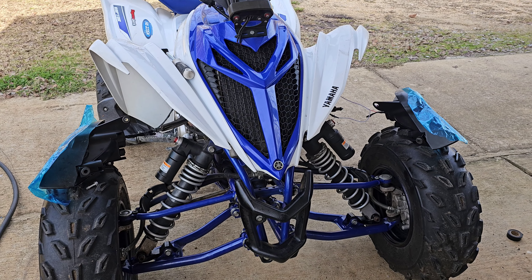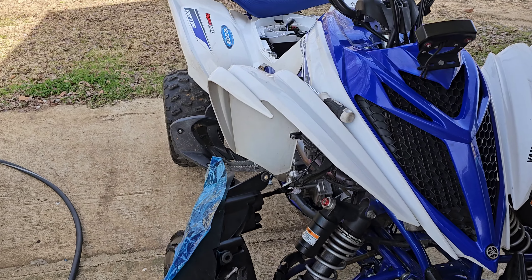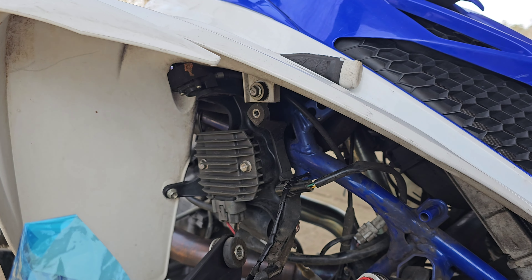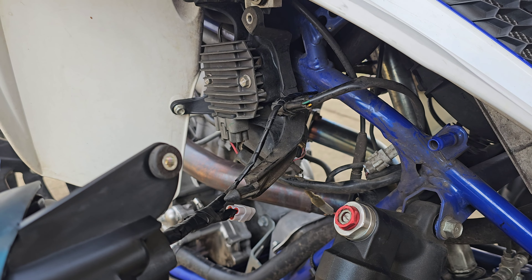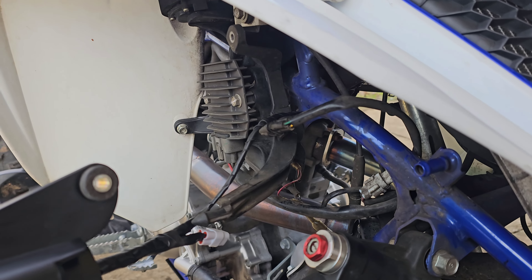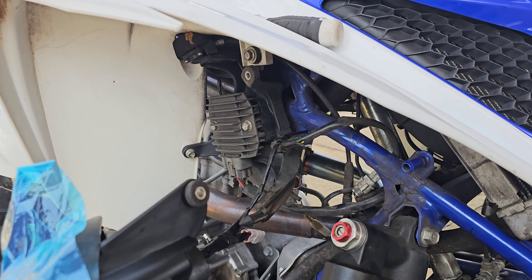Okay, so it is the next day. I'm basically done with the install but I'm gonna walk y'all through the steps. The first step is to remove your old headlight — it's gonna be one 10mm bolt at the top. Once you remove that, just tug outward on your headlight. Be careful not to break that metal bracket right there when you start pulling, because you will need to use a little force.